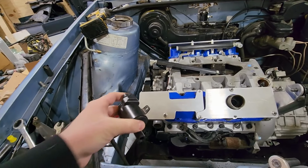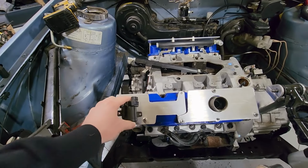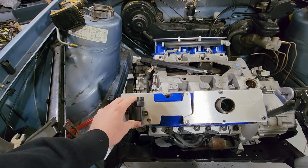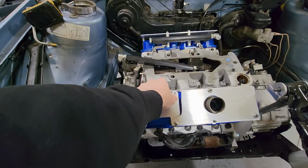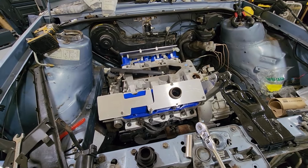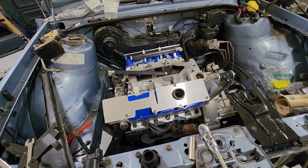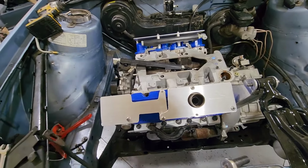because then that means I have to clear out all the space below the coil on the bracket for this to actually clearance this. That also means that the coil bracket will lose a lot of strength if I have to do that. So I would rather not have to do that. I think what the plan now is gonna be is to put some studs into the brackets themselves from the other side forward. So basically bolt in some bolts.